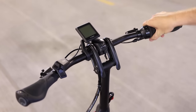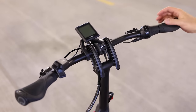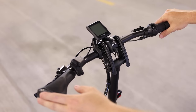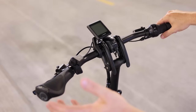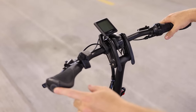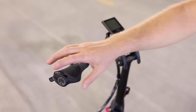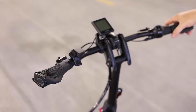This is the Shimano five-speed hub — and as with all internal hubs, it's really nice that you can shift the gears when you're not pedaling. There are really nice Ergon grips on here. One thing to note while up here: a lot of people want to add a mirror to their bike. The interior diameter of these handlebars is a little bit smaller than some others — I think they make the material a little bit thicker on the tubes inside the handlebar. As such, some standard mirrors won't fit here. One we often recommend is the Mirrycle mirror, but there are others out there — it's just important to know the actual inner diameter so you don't try to fit a bigger mirror and find it doesn't work.